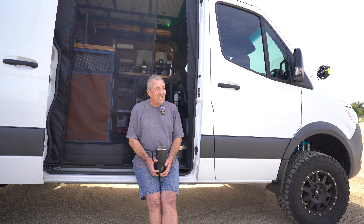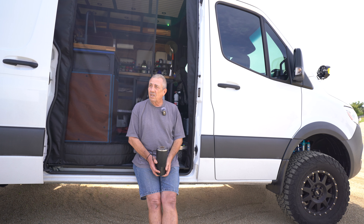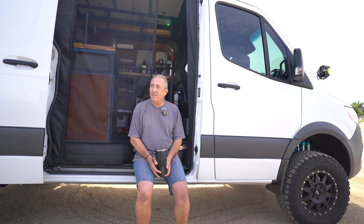But as big as that step was over stock, the Kings were that same step over the Van Compass. The Van Compass shocks soaked up the hits pretty good, but I still had quite a bit of body roll — it depended on the type of driving I was doing. If I was really leaning into a turn and hit a bump, that was an issue. At that point I was still running the front stock shock strut.